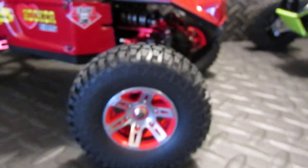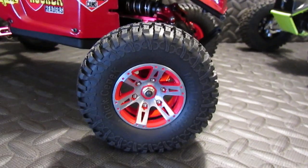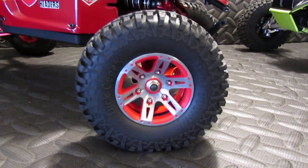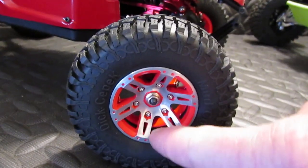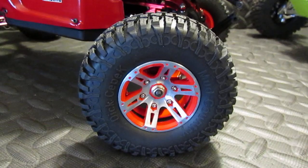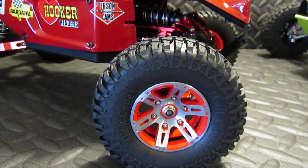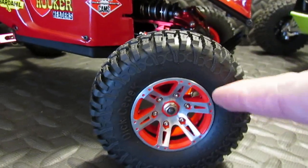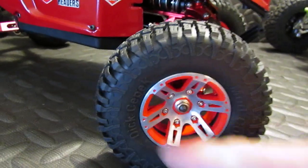But what you do with these is you'll put your inner ring in. Well, first you have to tape up the hole on the inner ring. So put a piece of tape on the inner ring, and I wrap that tape all the way around the ring so it doesn't come off. I put a couple of wraps around there, and that'll seal out the little vent hole that's on that inner ring that goes inside the tire you can't really see. When you seal that hole off, then put it in the tire and put on your back section and get it seated very nice. And get it seated on the ring as well as you can, the inner ring, on the front bead of the tire. But don't put your front section of your wheel on yet.